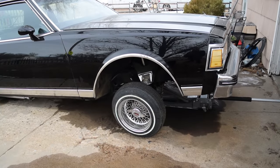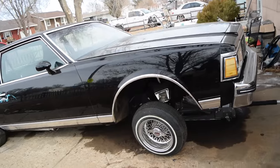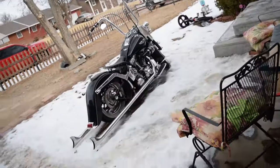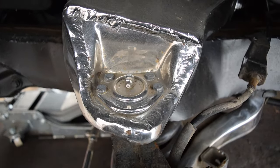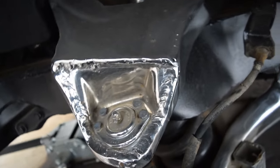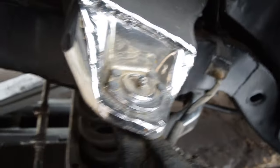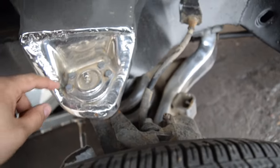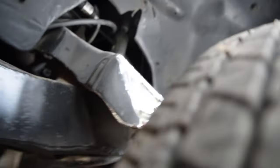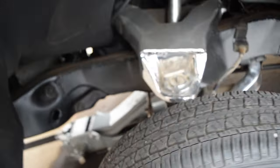Now we got her all the way jacked up, boys. Should have full access to be able to see everything we're doing. I'm going to try and possibly not remove the wheels, see how possible that is. Basically, you come in here and you got your four bolts on your A-arm. They even still have a little bit of movement. We're probably going to remove it first from our spindle down here on the bottom, and then hopefully that separates easily. Then we're going to pull these four bolts. I don't even think it has a cotter pin, so it should be easy work.